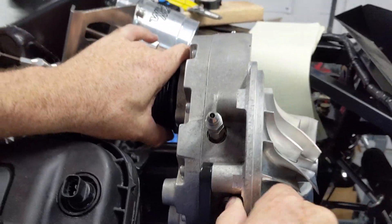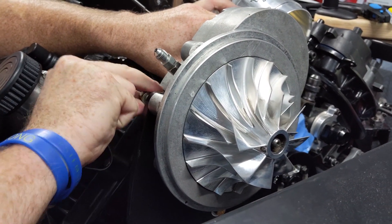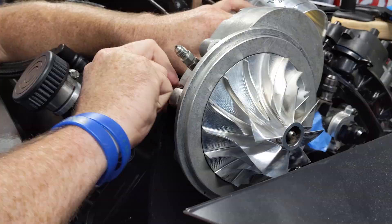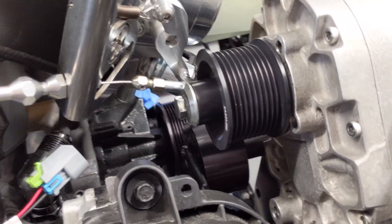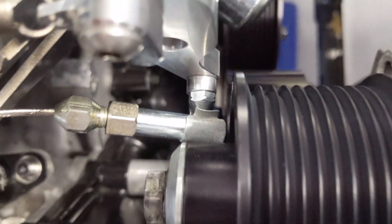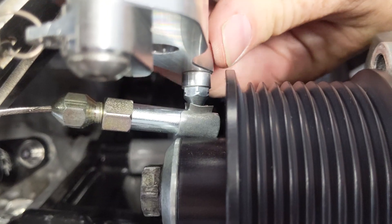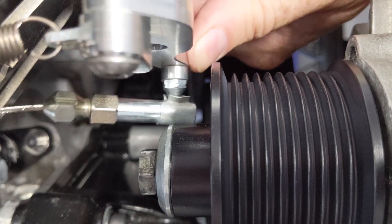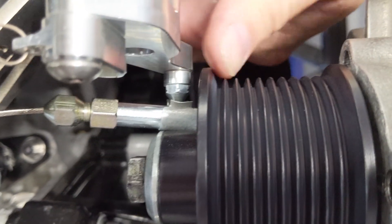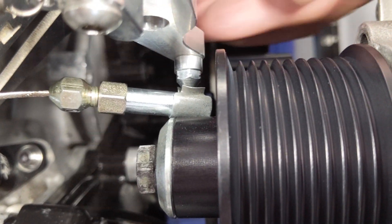How close is that? We're about to find out. That would suck to do the 10-rib and have to go back to an 8-rib pulley. Not happening. Put the 10-rib pulley on the supercharger and check out that clearance to the throttle cable. So much room there. It fits — a little fat finger can get in there. If this starts wobbling, we've got big problems. If this lets go and goes further, we've got even bigger problems.